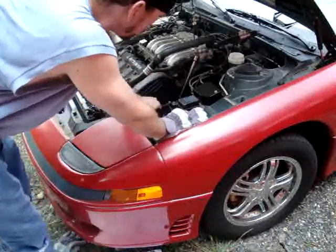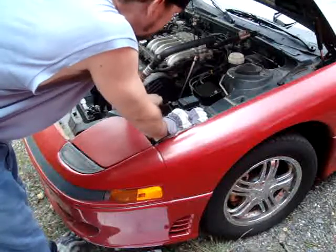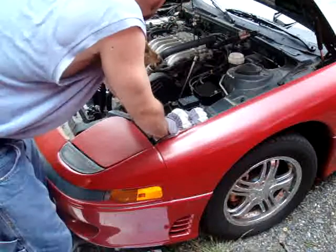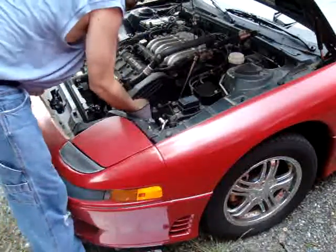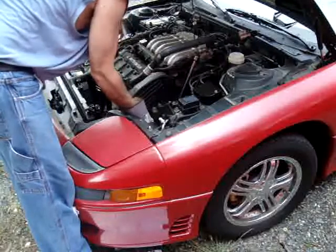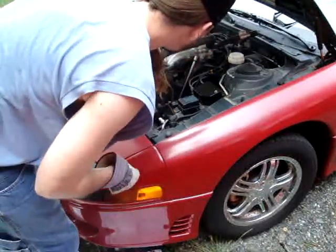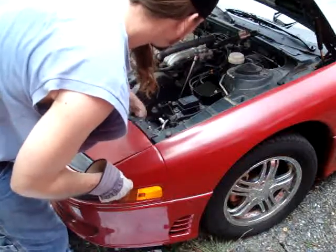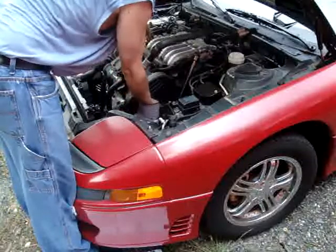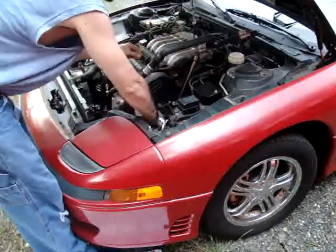I think I took the bottom one out first last time, which made it easier to get it out. So if you're doing this, you might want to try to remove this bottom one first. Leave the one just above it in, the short one, and might not have so much tension on the threads. I just threaded that top one back in, but maybe it did make it easier. So yeah, you want to remove the bottom one first. The long one first. That made it easier.